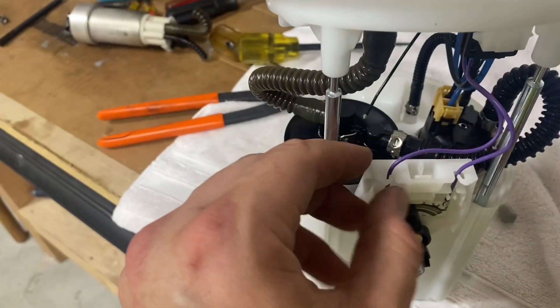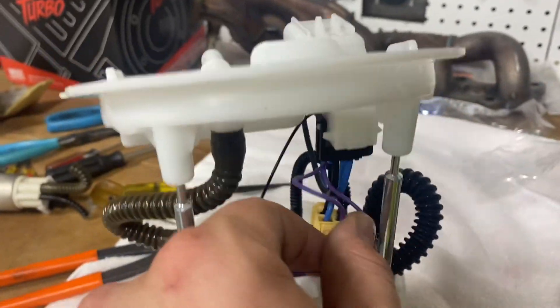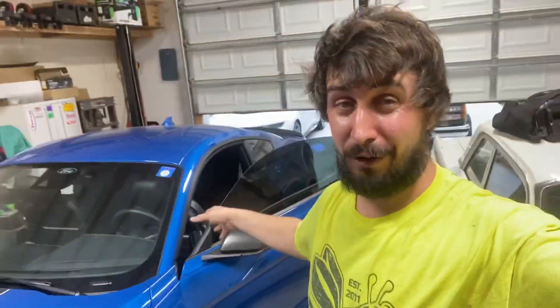Almost forgot - don't forget to install your float and make sure it clicks up into place. The wiring harness goes in and your wires are nice and out of the way. I'm pouring with sweat and it was really hot - it's 100 degrees in there with all those fumes. I did not film the last little bit, but I got it all put back in there. Make sure if you disconnected your fuel pump to depressurize the system, you hook that back up. Go get yourself some fresh air and feel accomplished because that was no fun. Thanks for watching guys, see you next time.